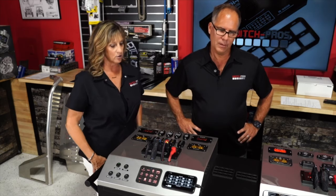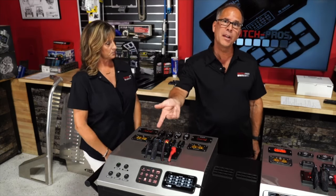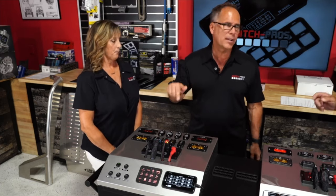You can also program a time delay so the panel auto-locks after, say, 10 minutes after ignition is turned off. A viewer named Tommy Dykstra commented that he's using two of the 12-switch units to run every single thing in his race Jeep. Another viewer, an engineer, commented that the switches are highly vibration-tolerant, making them suitable for racing.